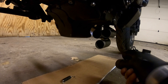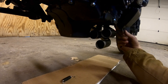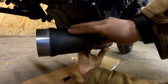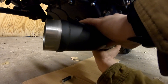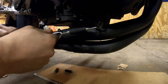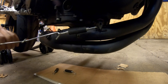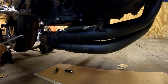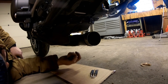At this point we're ready to install the collector. Make sure the pipes aren't touching the oil pan and that the breather tube is also not being touched by the exhaust. With the collector on the bike, we're going to use the spring puller that came with the kit to attach the springs for the exhaust. On this end you'll have two springs to attach.